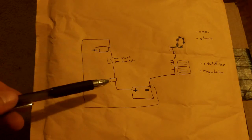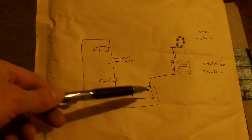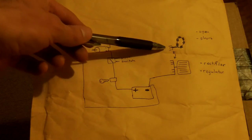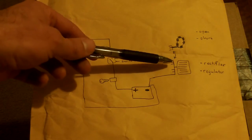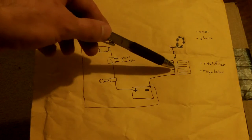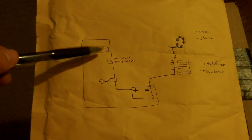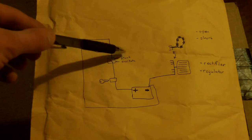Here's the starting side of the system. I've got the key, I've got the starter switch which activates this relay, I've got the starter motor and the battery. The battery has to stay charged up, so I have the stator which is an alternator on the inside of the engine. It sends its charge as AC current — electricity moving back and forth — and the bike can't use that, so it sends it to a regulator rectifier. This has diodes which force the electricity to move in one direction, that is direct current, and it also prevents overcharging. That charge comes out of this connector into the positive terminal of the battery. If I'm not getting the motor to turn over and I hear clicking, that's the relay not getting enough power — the voltage is low enough that it can't close to allow power through.